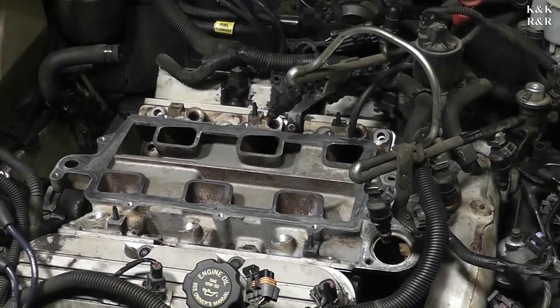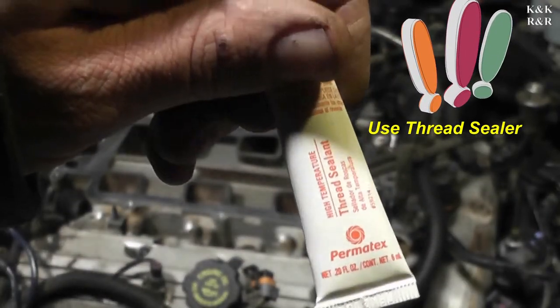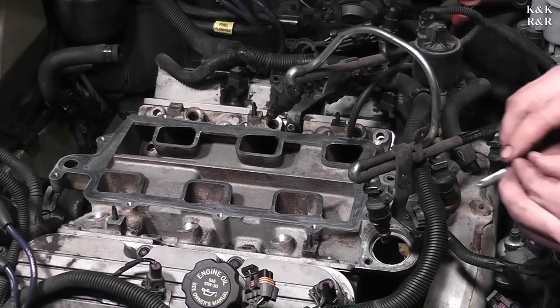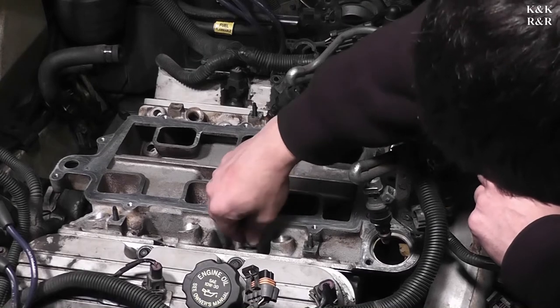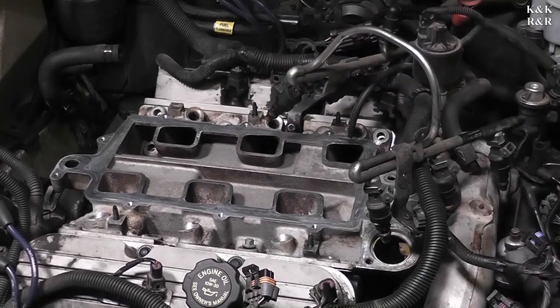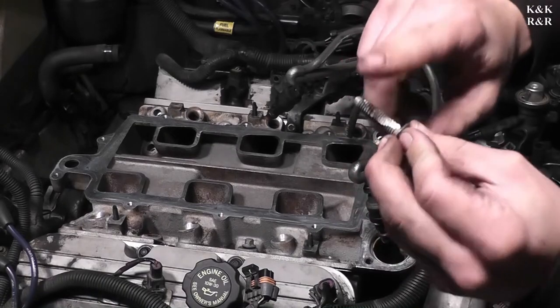What's getting the bolts on? One thing that's very important on this job: you must seal your bolts. Don't use RTV to do this — use the proper sealant. If you want the right results, use the right products. We'll go through the torquing procedure in a quick minute. We've got to get all these bolts loaded with sealant and then run them down. All your bolts should go in by hand — you should not need any extra force at all. Some might need a little give, but you should need no more than your hand to rotate it.